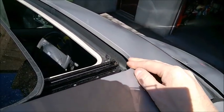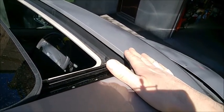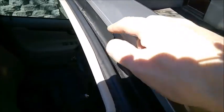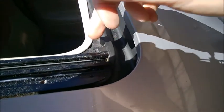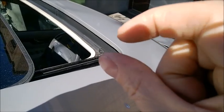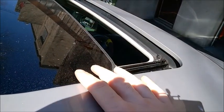Don't wait thinking you never park under trees — check the drains anyway. You can see this dust right here on the tray. This dust is from rain, and in time this is what clogs the drains, because they are really tiny tubes. The S60, V70 — the XC90 has larger ones so maybe fewer problems there — but again, don't wait.